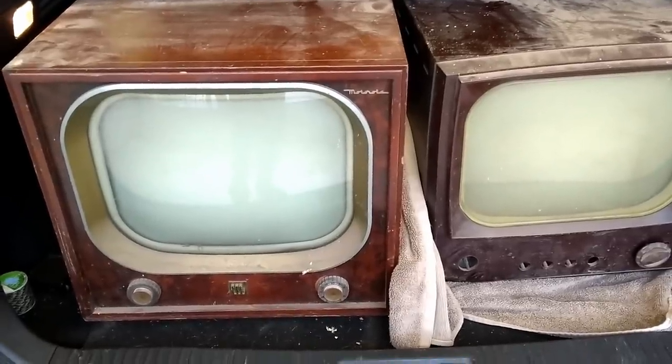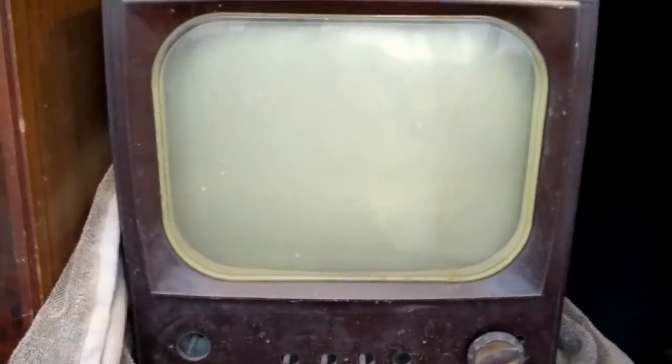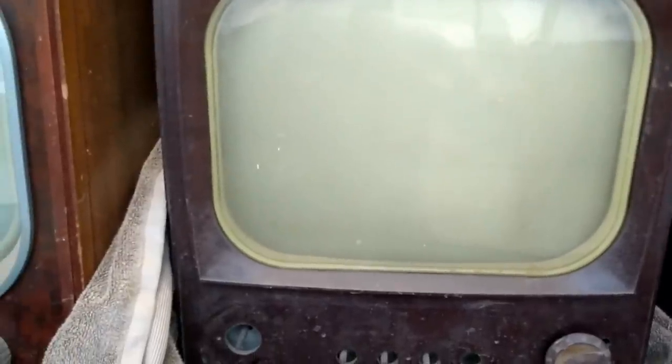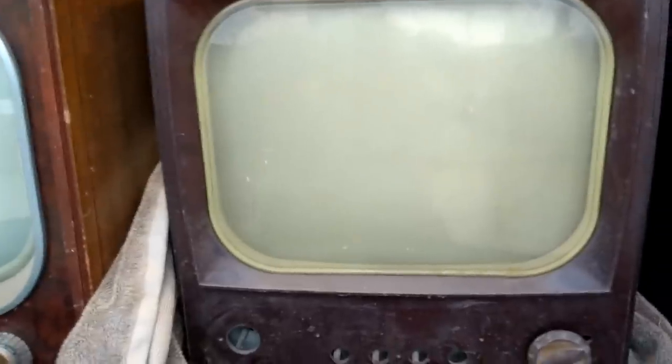1950 was when the rectangular picture tubes came out, and one or both of these I think are first generation. You can tell because they have really flat sides. The first rectangular picture tubes came in 14, 16, and 20 inches. The technique used to make them involved pressed glass for the front, then attaching the back — perfectly flat on the sides. They had to use really thick glass because air pressure on a flat surface creates a tremendous force. Within a year or less they came out with a more rounded design using thinner glass, going to odd sizes — 17, 19, 21 inch — continuing almost to today.